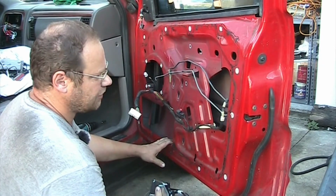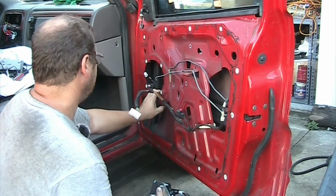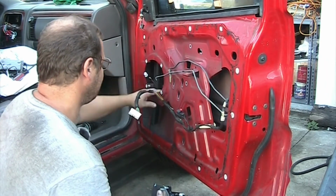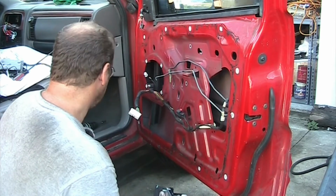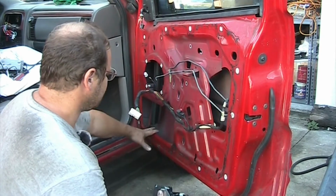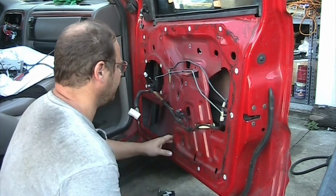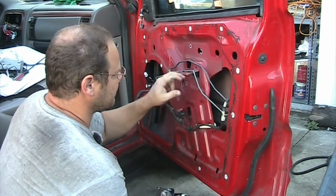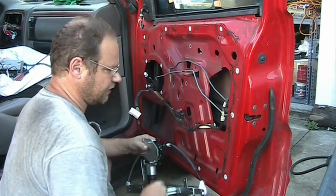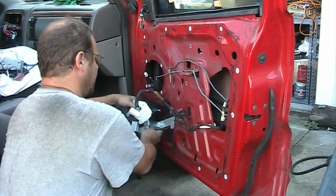It is a water shield, so that water is not coming inside the car. But if you want to protect yourself from actually getting water into the cabin, the much more important thing is that your gaskets for the doors work correctly, and then you actually work from the inside in your door and seal it with a spray glue adhesive system, so that all these holes, nooks and crannies are completely sealed. Otherwise it is only for like spray water protection. Anyhow, so you can put this in by pushing it in here.